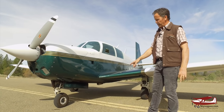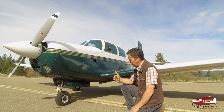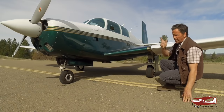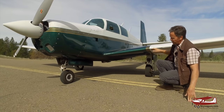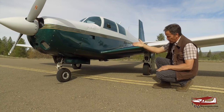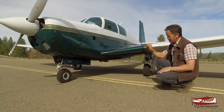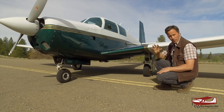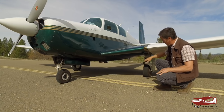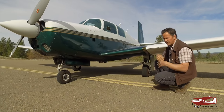Gear on both planes. The Mooney has very rigid fixed-position gear with rubber discs for suspension — three on the front, four on the mains, at about $112 each, needing replacement every five to seven years as they harden. The pneumatic tire and rubber discs are the Mooney's entire suspension, so they're not well sprung — you must land nicely. Repeated hard landings crack the fuel tank sealant, since the gear bolts to the outside of the fuel tank on the wing. This particular plane has had electric gear retrofitted — originally it would have had the big Johnson bar manual lever.